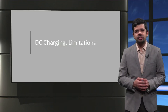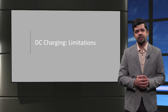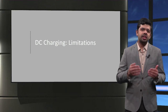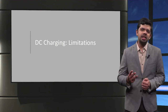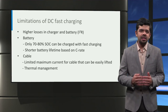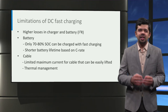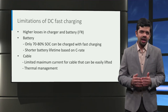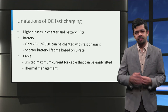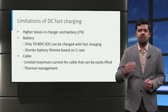Fast charging is quite attractive because of the very high charging powers going all the way up to 300 or 400 kilowatts, resulting in very short charging times. But fast charging power cannot be increased infinitely, due to three technical limitations. The first limitation is that high current charging leads to high overall losses both in the charger and in the battery. For example, if the internal resistance of a battery is R, the losses can be expressed using the formula I²R. You will notice that losses increase by a factor of 4 times whenever the current is doubled.